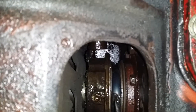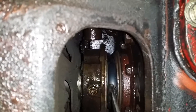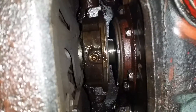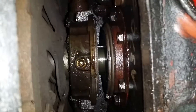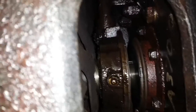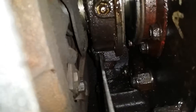What you do is stick your tool up in here and make sure that you have a half inch — you can see that you do, that's good. Next, you check between your throwout bearing and the fork to make sure it has an eighth of an inch. You can see right there — that's good.